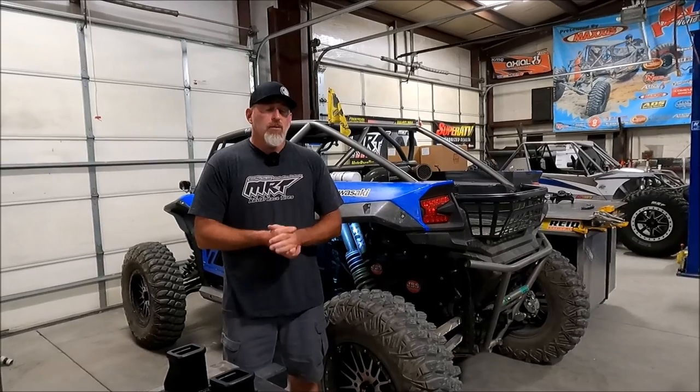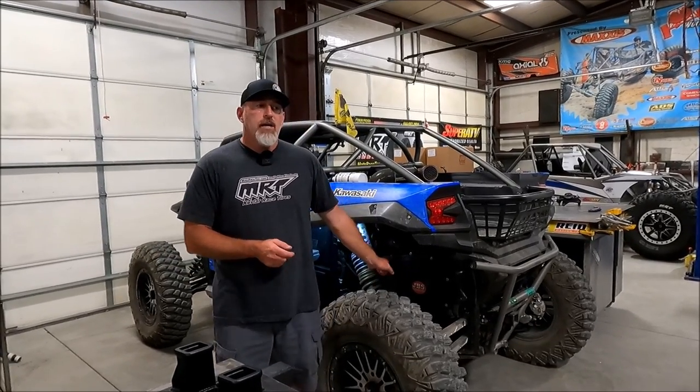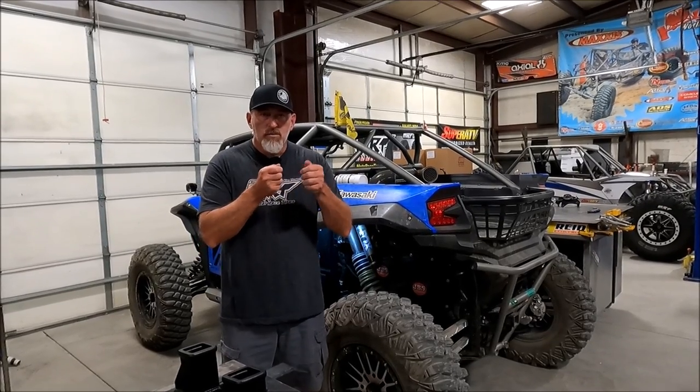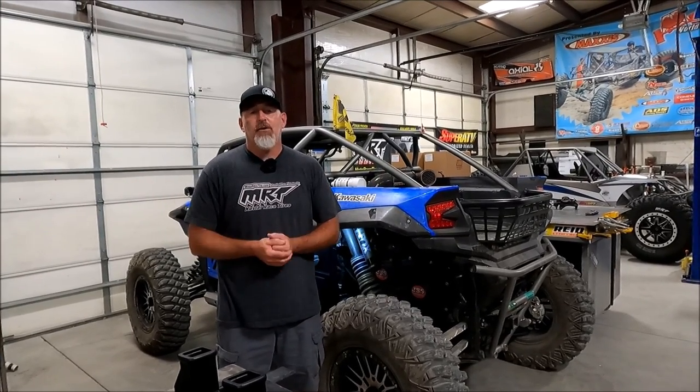Talking to James from JBS — we're standing in front of the crawler KRX. This thing has James's cut sheaves and clutch weights with the G-boost belt in it. One of the things James noticed is he did this mod to his car and noticed an insane performance improvement. I have another story of a guy who kept having issues, brought it to the dealer three different times, was having multiple issues — cutting down, going to limp mode, and flashing LR on the dash. I recommended he look at the coil packs, take off the little coil spades, slide them back on, use a little dielectric grease if he wanted, and do the grounds. He called me back and said it has never done it again. He was super stoked.